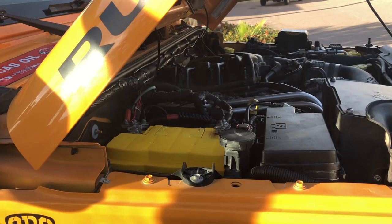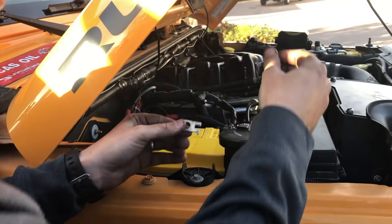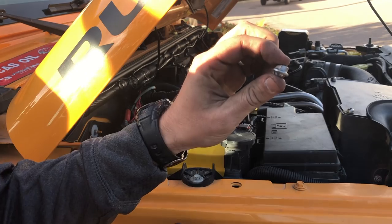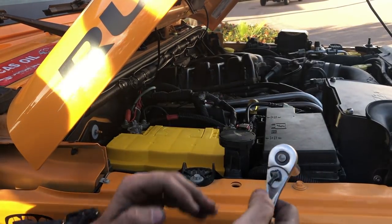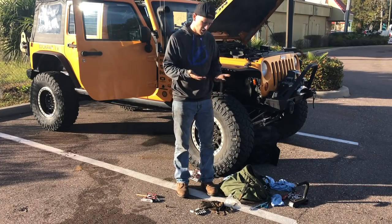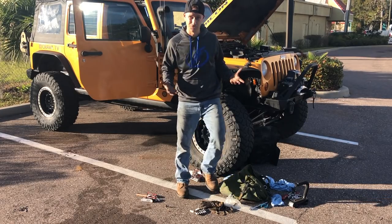And now the final piece of the puzzle that's remaining is reconnecting our battery here. Drop that on there. This little piece goes over here. And then we've got this acorn-shaped nut that you should never attach an accessory to on either terminal. That on and tighten down, and then we'll fire this thing up. All right, so all six spark plugs are changed. Now we just have to fire it up and see if it runs.